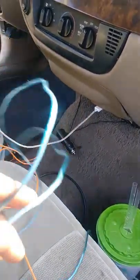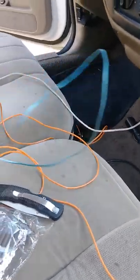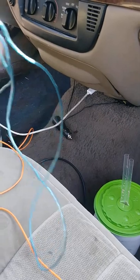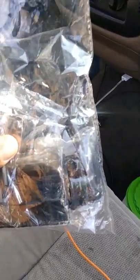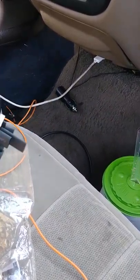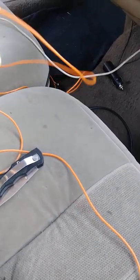I have enough remote wire to run it, but I also have a second piece here just in case. And what do I always say — it's better to have and not need than to need and not have. So just in case I need to mount my amp somewhere in the trunk, I can do that because I have more than enough. I got a pack of heat shrink I ordered online — it's great to use because it encloses your wires so they're not exposed and it makes everything look neat.